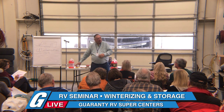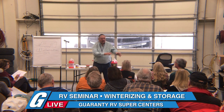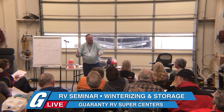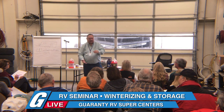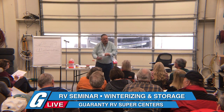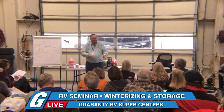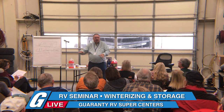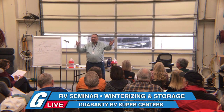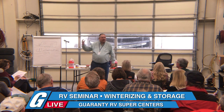Before you close that valve, go in there with your camp bucket and dump the camp bucket down the toilet. That's one final rinse to get everything out. Now close your two tanks. What I do is I take my camp bucket now a second time, put my two scoops in, fill it, dump it down the toilet, and leave it as long as it's not going to freeze out. That two to three gallons of water plus that chemical, it volatilizes and it's a vapor in there, and that organic tissue is getting eaten, the toilet paper is getting eaten.